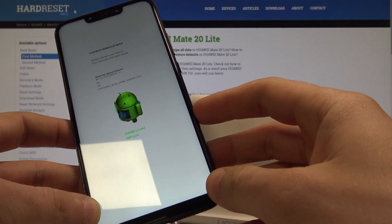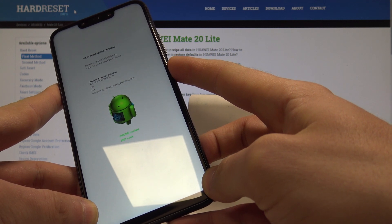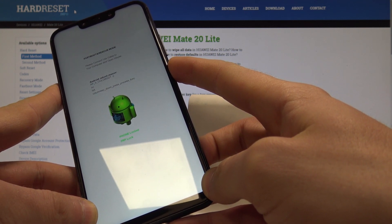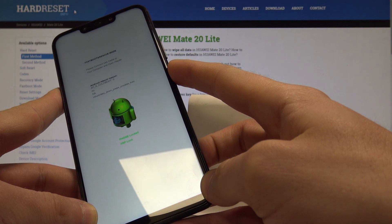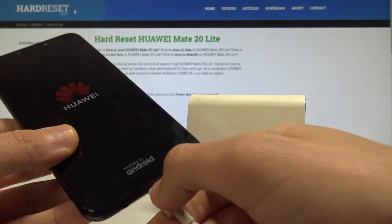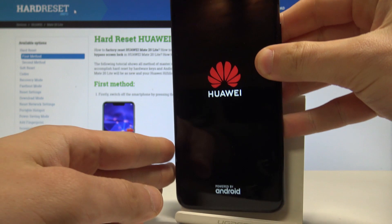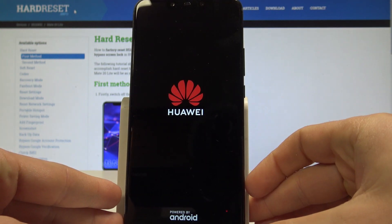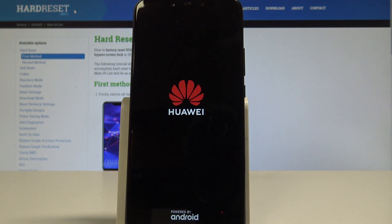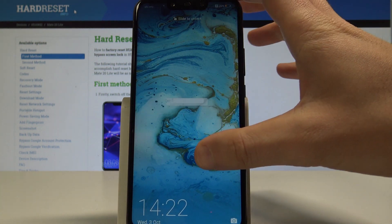You can use your fast boot connection from here. If you would like to quit this mode, press and hold the power button for a long time. Release power as soon as the phone goes black. You can also disconnect your device from your PC and wait until the device boots into normal mode. Everything went well — you can now use your device.